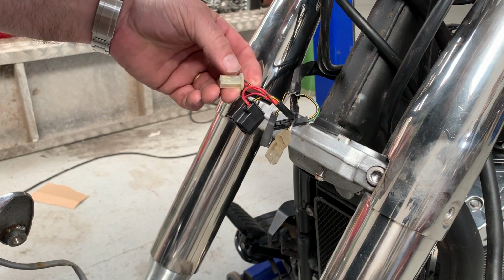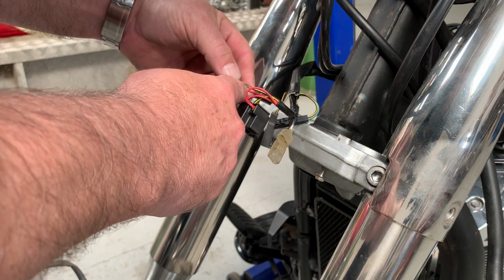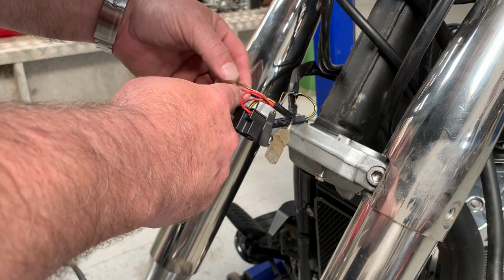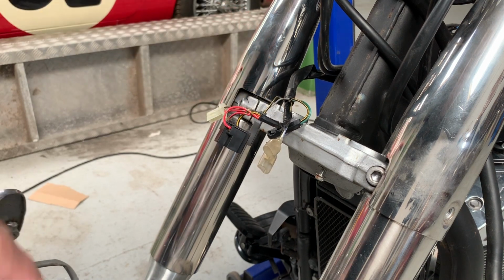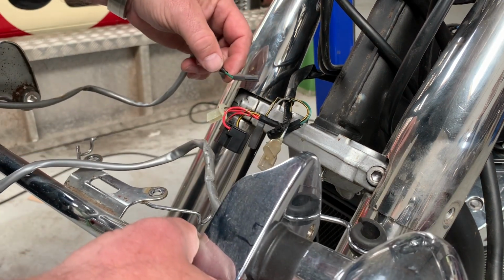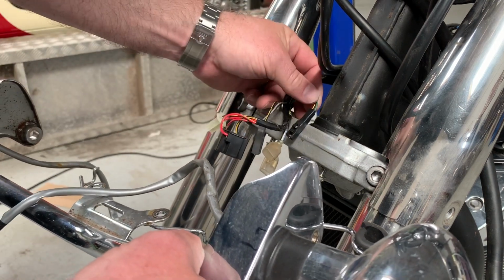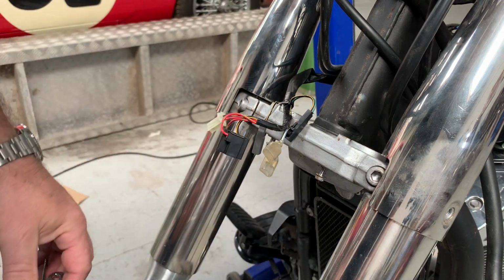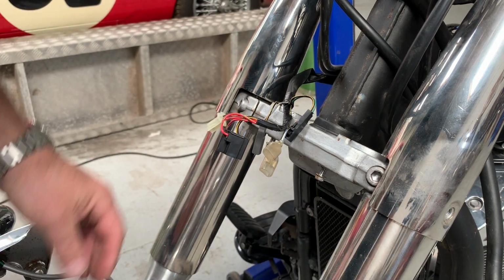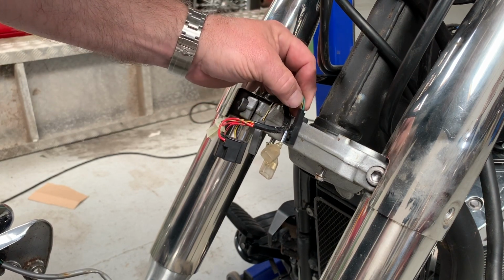This is a side light, but there is some knowledge we can gain from this. And this side light is red. So let's remember, red is side light. Now this wire, which has a grey plug, goes to the right hand indicator on the indicator bar. And this plug, which is black, goes to the left hand indicator. Now, we can gain some more knowledge from these. Grey plug, grey wire. Black plug, green wire.